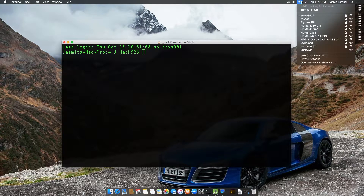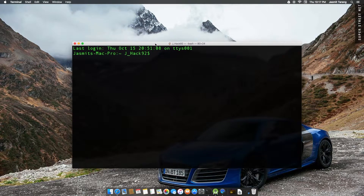Once you get there, the other way that you can check is on your WiFi networks — you're going to see a 'Setup99C2' or whatever network name is on the sticker on the bottom of your OnHub. They're going to have a network name or SSID. Just make sure that shows up and you can connect to that. Your previously set-up network name is not going to come up because you're booting off the developer image, which boots up the default settings.